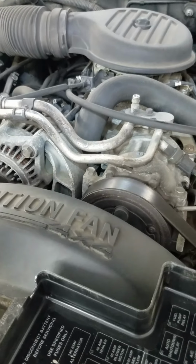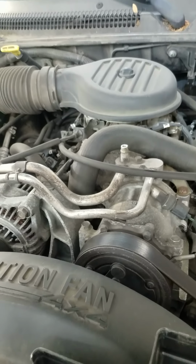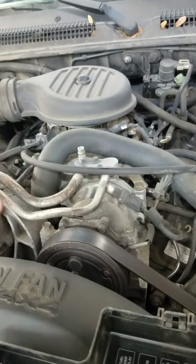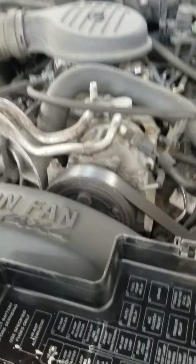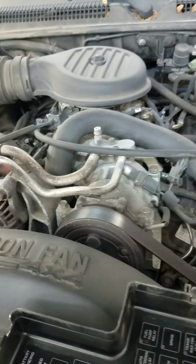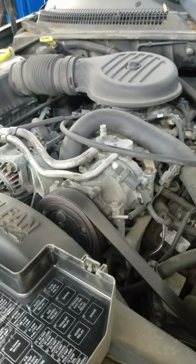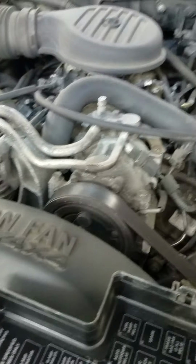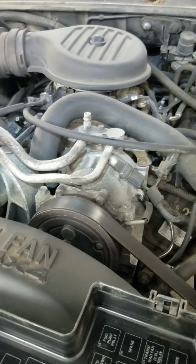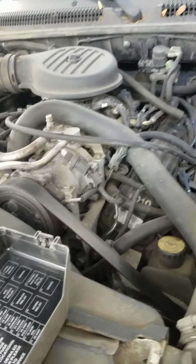Another problem with that is if you don't have a vacuum pump and you're just, like this one, there's nothing in it. So if you know that all the refrigerant has come out, the air can get in. And with the heat cycles getting hot and cold, you know that the air has gotten in there. So when you put that on there and you pull the trigger, it puts the sealer in there while there's air in there, and it already starts hardening up anyway. So you might get a little bit of success with it, but eventually it's going to clog up the expansion valve and the compressor and the condenser, and it's just a waste of time. Buy the stuff that has no sealer in it, or just take it to somebody that has a machine and let them do it right.